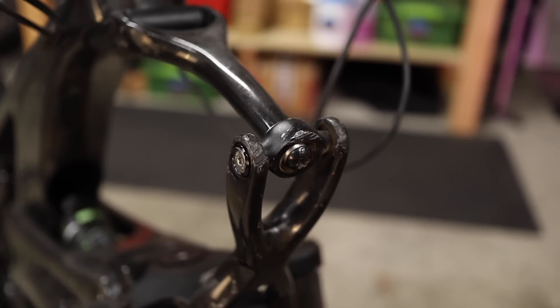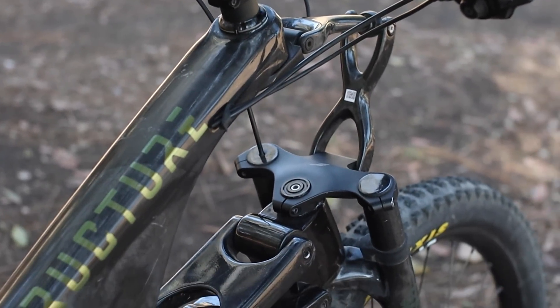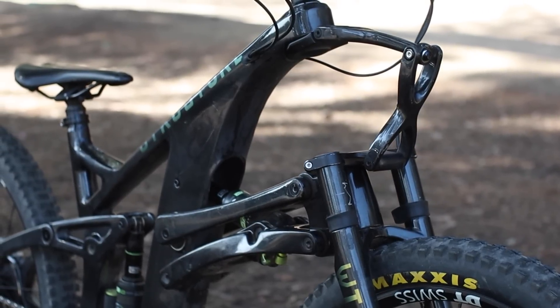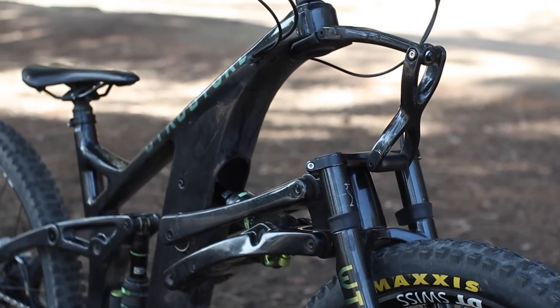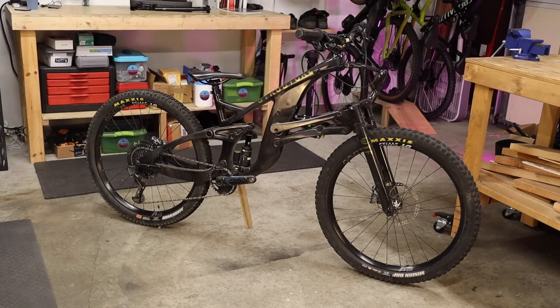First is with the spherical bearing at the front steering linkage. Because the fork and handlebars are totally decoupled, they need to be connected by another linkage that can compress as the front wheel tracks over bumps. While this joint only supports a lateral load proportional to the steering torque, it's still critical — any play whatsoever would result in a disconnect between the handlebars and the wheel, which would be very bad. As for price, some might say the frameset is prohibitively expensive at $5,500 US in mid-2022. However, the frameset cost does include both shocks, and you wouldn't need to buy a fork since it's all integrated. When you look at a high-end carbon frameset plus the cost of a high-end telescoping fork, it's really about a wash.